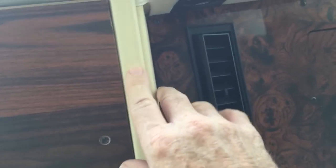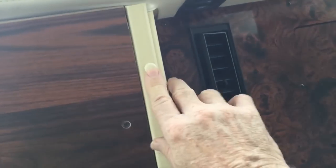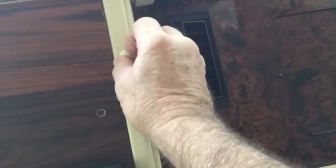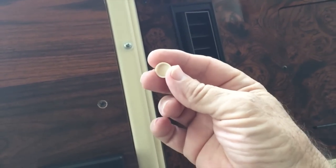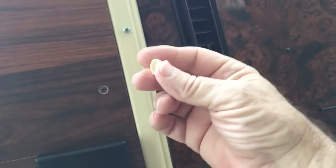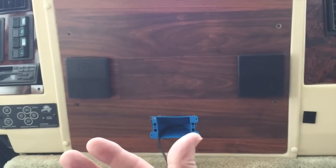One of the first things you're going to be looking for in these is these little buttons along this trim. There's a trim package here that goes around the television — it might be in chrome, it might be in wood, it could be anything. These little buttons are a plastic cap, and you can generally get them off almost with your fingers or your fingernails. If you have a proper upholstery tool, you can pop these caps off and get the screws out. Once you get the screws out, carefully pull this trim back away from there.